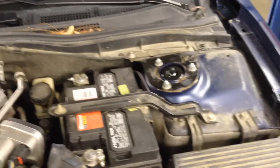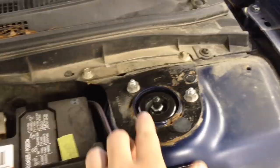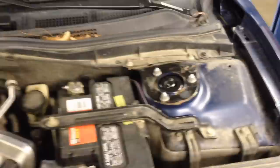After that, throw your wheels back on, torque them down, and then once the weight of the vehicle is on the suspension, you can come over here and torque down these three nuts on here. And I'll put all the torque specs down below in the description. Okay, now also, while the weight of the vehicle is on the suspension, we want to torque down that lower bolt that goes through the lower control arm from the shock fork that we just snugged up earlier. Now's the time to torque that down.